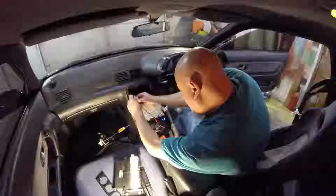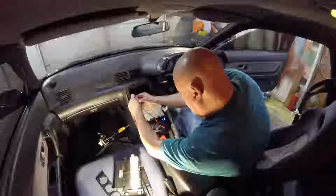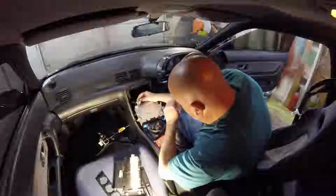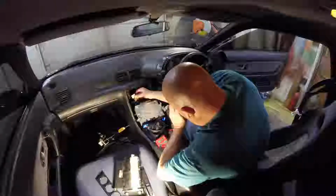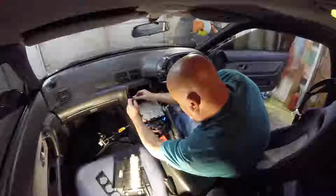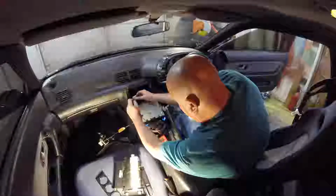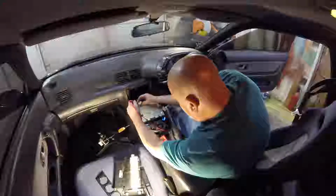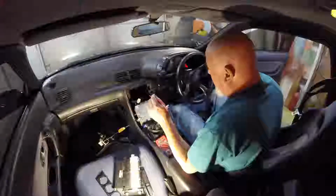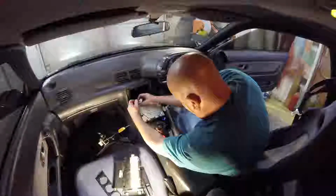That's very depleted. That's 2.3 volts. Okay. So 2.3 volts is coming out of the yellow with red stripe, so that must be coming from something else. But this one is definitely ignition on. Now, turn the headlights on. Let's see where that comes from.